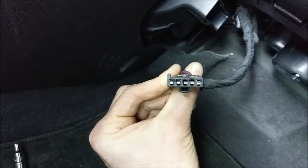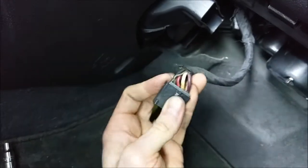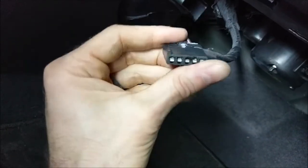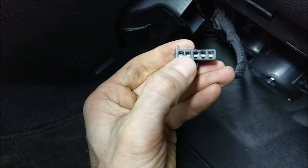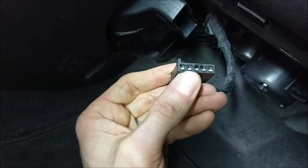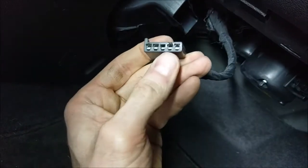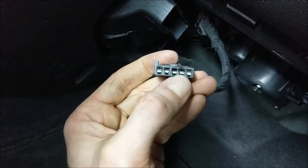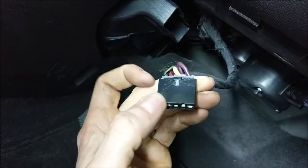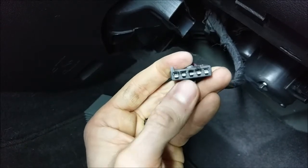You can see on the signal pin all the way in the far left corner — that guy is fine, happy. He's got to be a thin wire spaced away from the other high-current ones. The second from the left has sprung up the highest, proving it even more: if you jam all three high-current connections all in a row packed next to each other in this connector, it's too tight and these things get too hot. If you keep the higher-current one farther away from the bunch, it gets more heat dissipation — that's why he's alright. And of course the signal wire is alright too.